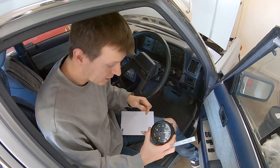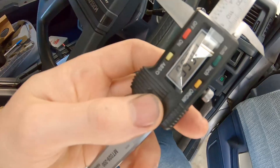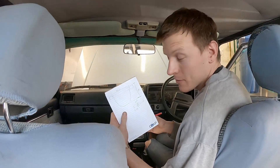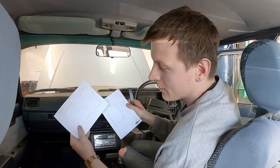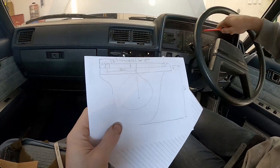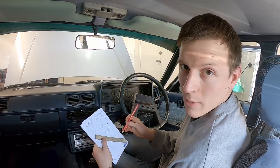You can go to town 3D printing - it doesn't matter if you make a mistake, you can try again. Now I'm armed with my sketches - I've got a side view and a front view, that one more to scale. My curves are a bit rough but it's easier to do curves not by freehand. These are the main measurements we need. The good thing is the panel this part sits on is actually flat, so we don't have to take a curve into account, which makes it easier. If your car is curved you will have to model that in. We'll take these to the computer and draw up a 3D model and make some variants.